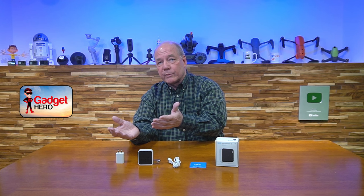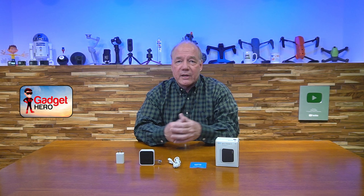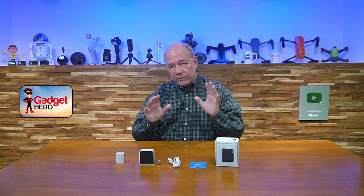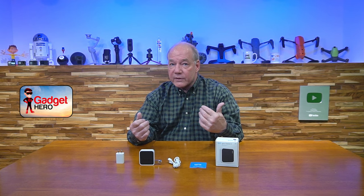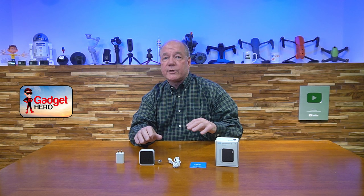Where it becomes really interesting is if you don't have a subscription — you're actually recording the videos right to the thumb drive, and then you can pull the thumb drive out and go review those on your computer. I almost feel like if you don't have a subscription, it's a better setup than if you do. It's a little confusing, and it may very well be something the Blink team and Amazon work on down the road to allow you to store videos there, or at least give you the option to store raw footage right on the drive, just like you would without a subscription. Those first 30 days you're recording to the cloud and it's backing up nightly to the thumb drive. If you let that subscription expire after 30 days, you're now in an offline mode, and all of a sudden you'll see videos recorded to your thumb drive. So depending on what you're trying to do, you may want to set some cameras up on a second account without a subscription and record directly to the thumb drive.